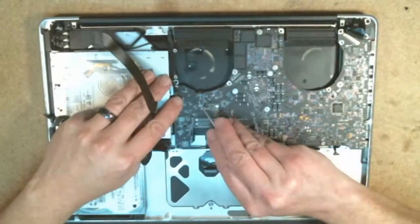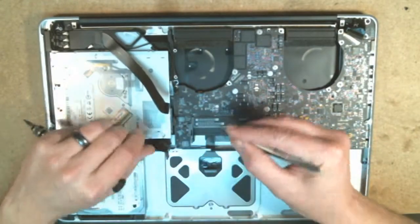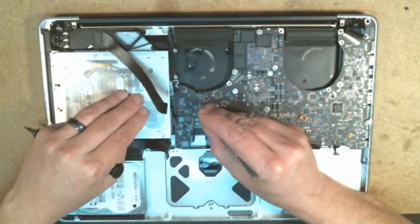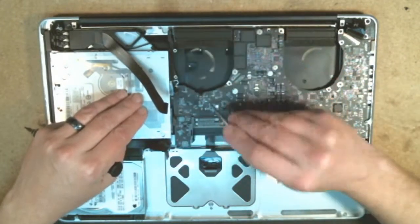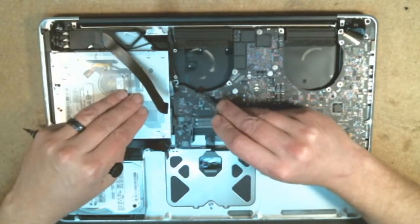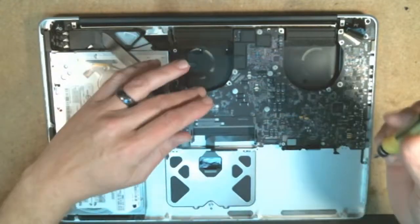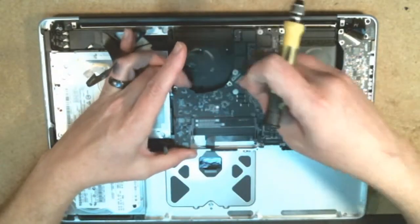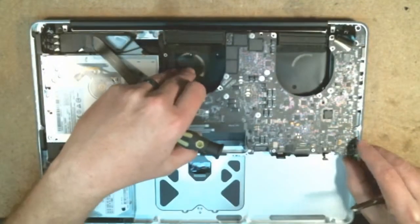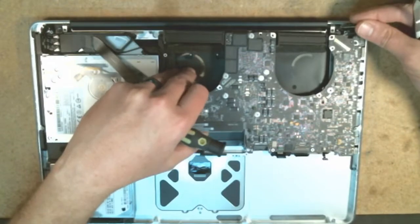This back here, there's a small, tiny cable right here next to the fan system that you'll need to deal with. So just tilt up there, and then slide this cable. This is kind of the critical one. A lot of people miss this during the reassembly, and so just make a note where all of your cables are hooked up and whatnot as far as this process goes. So at this point, the board starts officially releasing out of the connectors here.